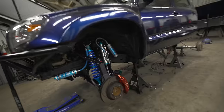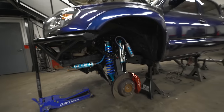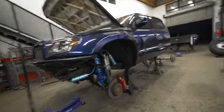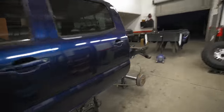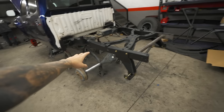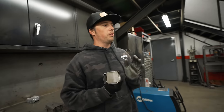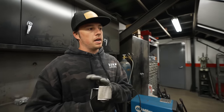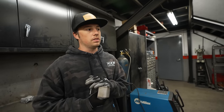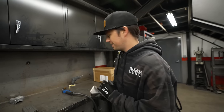I'm so stoked for Dustin - look at all that beef in front of this truck, and that's only the front! Cannot wait for you guys to see the back and what Taylor's going to do to it. I'm going to cycle the rear end today, throw the bump stops in, strip the leaf pack down, throw the front hangers on, and then we can start cycling and tabbing the axle out for the shocks.